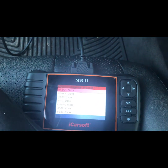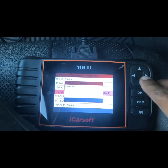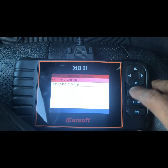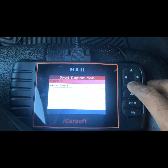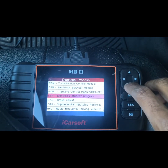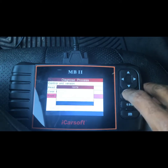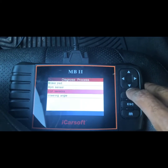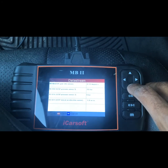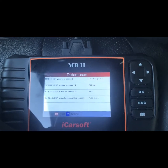I'm going to go to the scan tool, click OK — that's just the version info. The car is running; I just gave it an oil change. Go to 16-pin, select 320, and do a manual select. Going to ESP — read the data stream. There are the ESP sensors: pressure sensor one is reading 255 bar, pressure sensor two is reading zero.